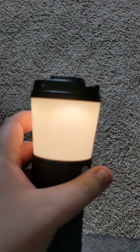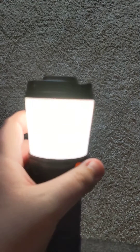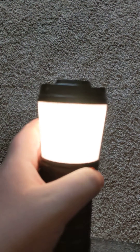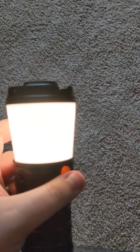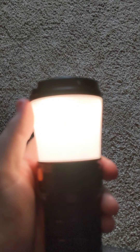Now my color temperature is tied to the brightness. So if I ramp up, it gets cooler. If I ramp down, it gets warmer. That works either direction, but I can still set the color temperature independently with a click, click, hold. And if I just release somewhere, it will stay at that color temperature and will not be tied to the brightness ramp.